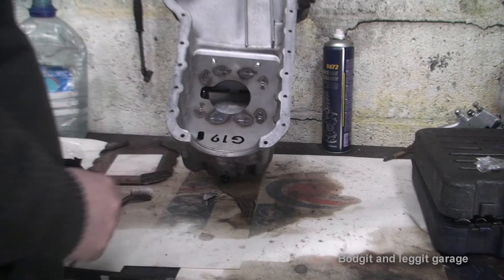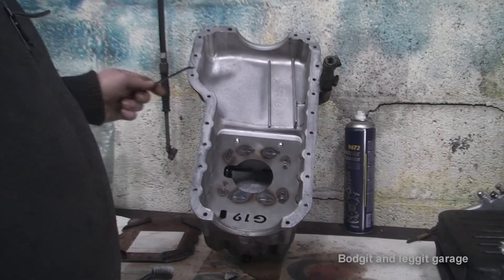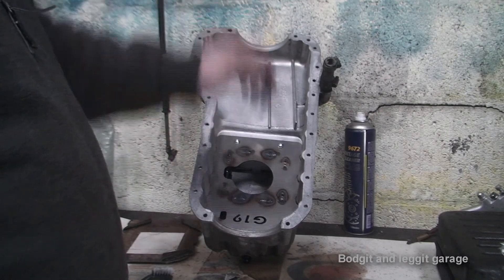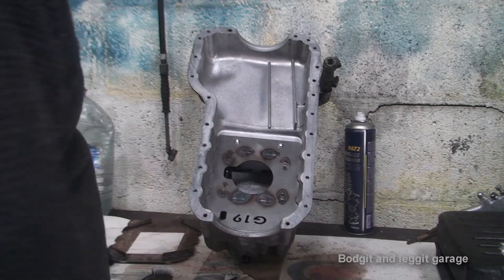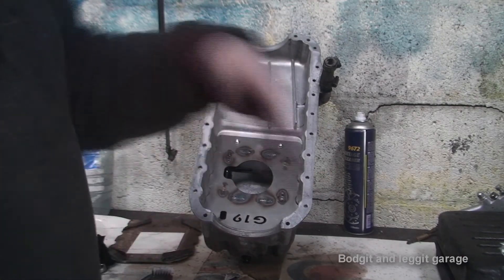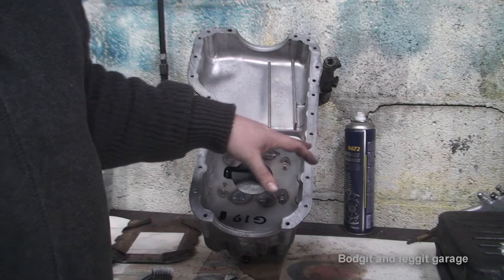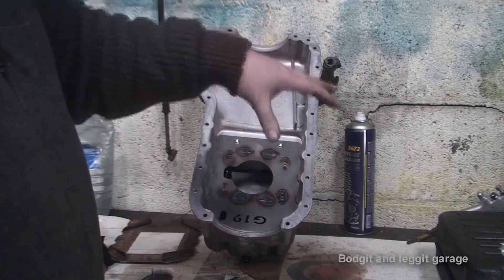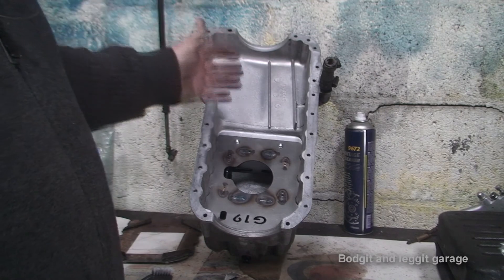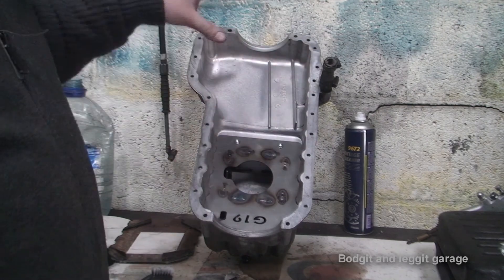Right, what I'm going to do is just tighten these bolts up, and that's basically it — that really is as simple as that. The next video we're going to do is actually putting this onto the bottom end of my engine with the oil pump and everything. I'm just waiting for the gaskets to come through, and at least then I'll have the bottom end of my engine done. Another thing I would say before I go: if you're going to be like me and not use this straight away, put it in a bin liner and wrap it up so no bits of debris can get into it. There's no point cleaning all this and leaving it in your workshop for it to get full of crap again. So I'm going to put this in a bin bag, wrap it all up, and when I come to use it, take it out and it's all going to be clean again.